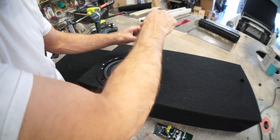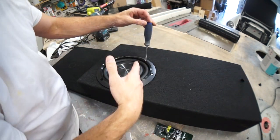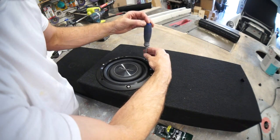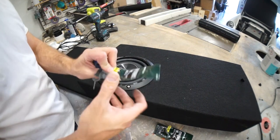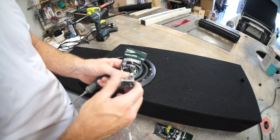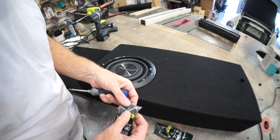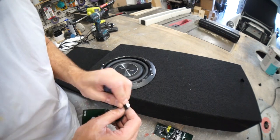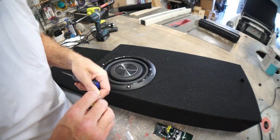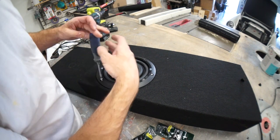This is going to mount to the driver's side, the amp mounts to the passenger side. So the woofer's towards the middle so it fires right up your butt crack - give you that ass bass. I did T-nuts on the side, on the outside of the carpet, with a bolt going through the inside of the box, with wing nuts on the outside for a little wing nut terminal.